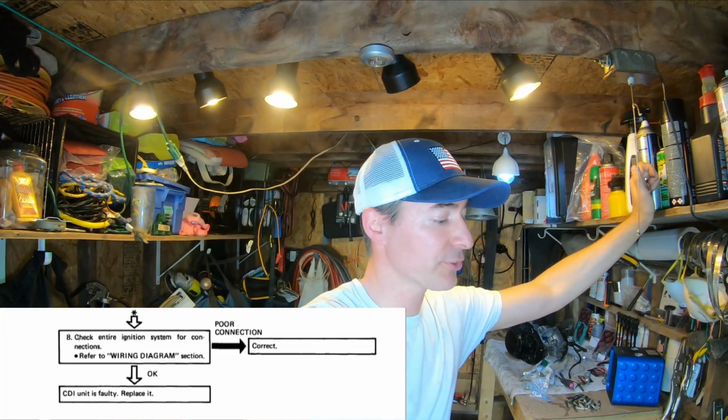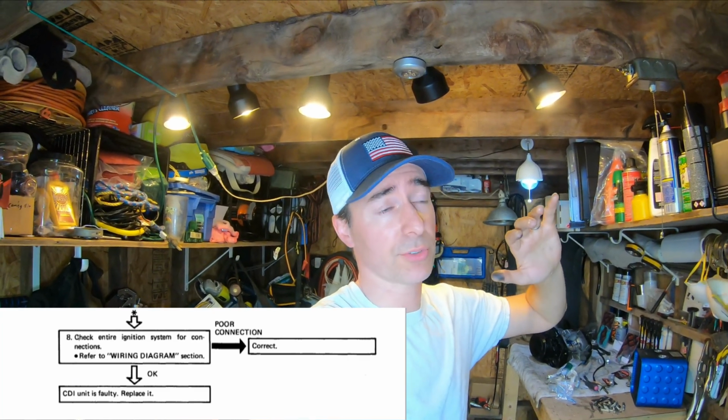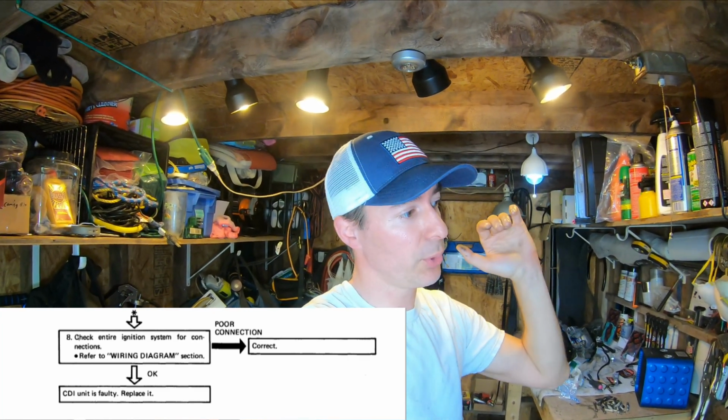So from there, you're looking for faulty ground wires. Easy test. Put your voltmeter on to 20 volts or so. Put your positive on the positive of the battery. Put the negative on the grounding wire that goes to the motor, and test your grounding circuit there. You should see 12 volts or so. Also walk through your harness. Look for bad grounds if you can get your fingers on anything. Did that. Nothing. Still no spark.